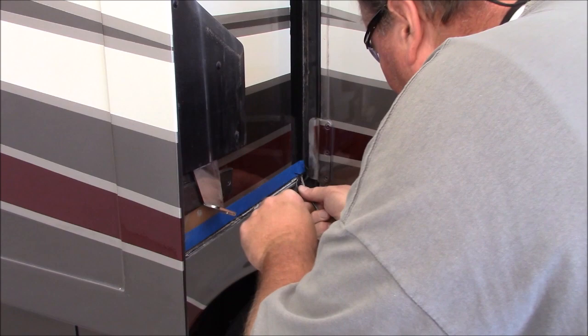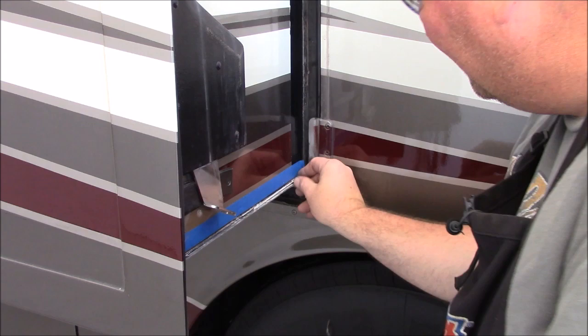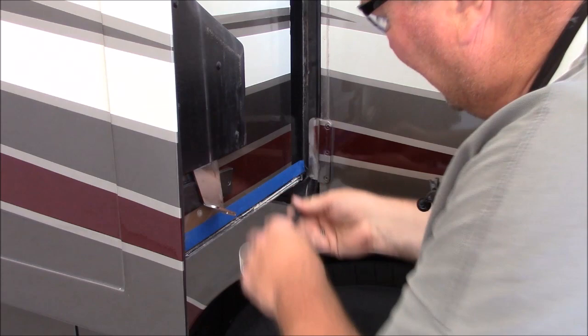take and get a hammer and drive. I've got an old gasket scraper here that's hardened, so I sharpened it up a little bit, and it actually cuts through that aluminum channel pretty decent. And it will go back inside of there, and you want to get that last little couple inches piece out